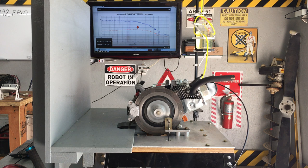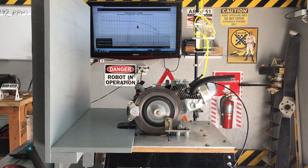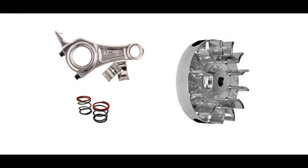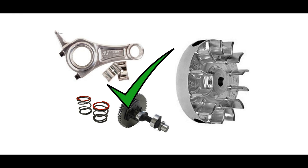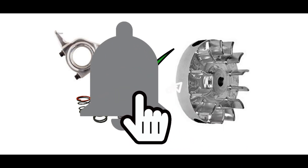This video series was filmed during the worldwide pandemic of 2020. Unfortunately, these 212cc engines are temporarily out of stock everywhere. Now blowing up one of these engines on a dyno would make great video, but it would seriously affect the production of future videos. We did a few dyno runs on this stage 1 engine without a governor and it really screams — it's borderline dangerous. In the interest of moving forward, we decided to run the engine with a modified governor adjusted to keep the engine RPM inside the power band — we cap the RPM just above the point where the engine makes maximum horsepower. The good news is the modified governor doesn't affect the results, and you can look forward to future videos where we modify the engine with a billet rod, a billet flywheel, stiffer valve springs, and a camshaft. These billet parts will actually decrease the risk of the engine exploding on the dyno. Now would be a good time to click on the subscribe button and the notification bell — now let's get back to the dyno video.